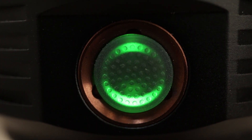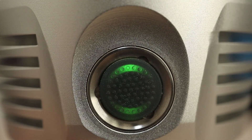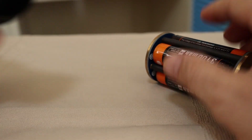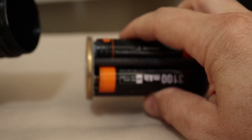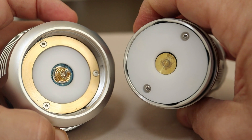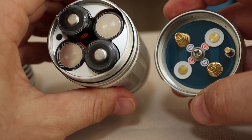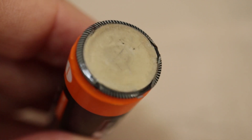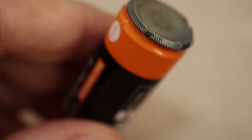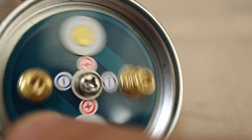Before we had a kind of breathing switch, whereas now we get one that's not breathing. One of my personal favorite upgrades besides the brighter light and higher power is that instead of the battery carrier in the old version — where you would take it out and put your batteries in — you can now just slip them into the body. This not only gives us more metal for heat sinking, which is fantastic, but I like it better because these battery carriers have a tendency to be kind of hard on the cells, on the shrink wrap. They wear them out pretty quickly, and I don't like snapping them in and out. I definitely prefer this design.